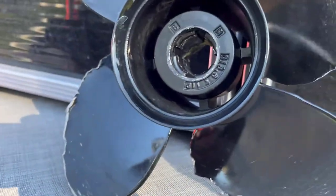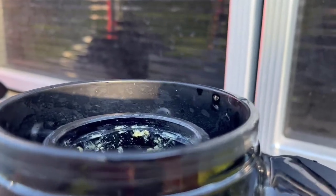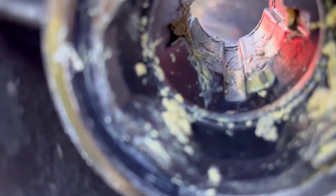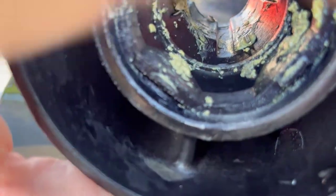That spline unit I'm going to reuse. We assumed that with a new prop I would be able to press out that plastic hub adapter inside. But we did some good damage to this prop — you can see the aluminum got a good beating. As I looked at the hub and started to look down the splines, what you can see is that we did enough damage that we've actually cracked the plastic hub. You can see that crack right there — it starts, works its way down along inside, and the crack continues on at a bit of an angle.